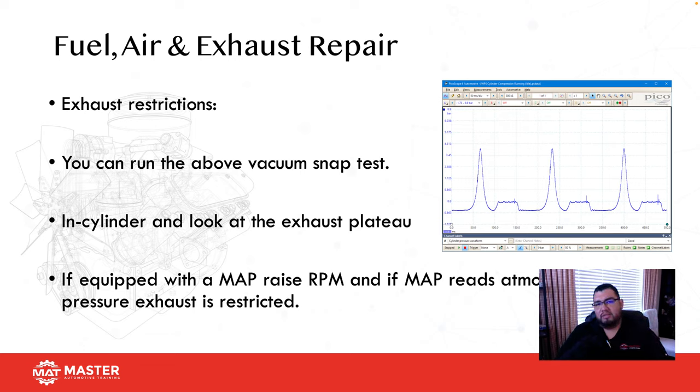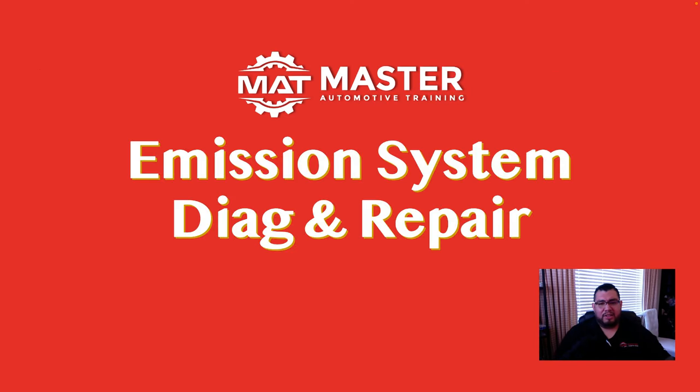The other way of doing it is if the vehicle has a MAP sensor, you're going to raise the RPM and hold it at about 2,500 RPM. If your MAP sensor continuously shows atmospheric voltage or pressure, what does that mean? That means that the intake manifold pressure is equal to atmospheric pressure, which there's no way, because vacuum is what? Vacuum is intake manifold pressure minus atmospheric, right? So it's less than. If they're equal, that means that you have an exhaust restriction. So that's another way that you guys can take a look at that.